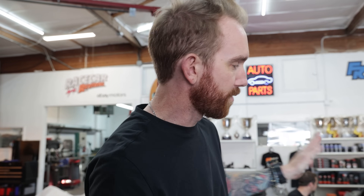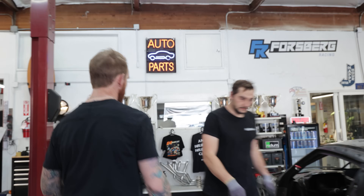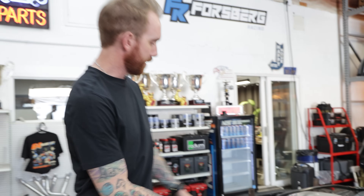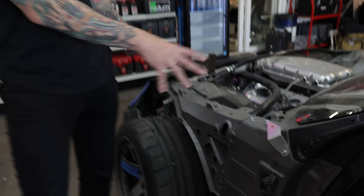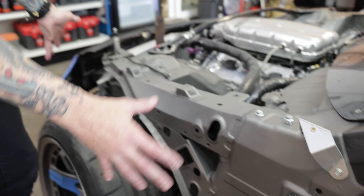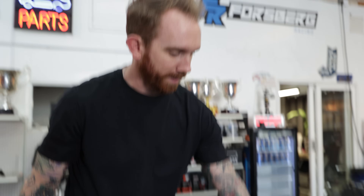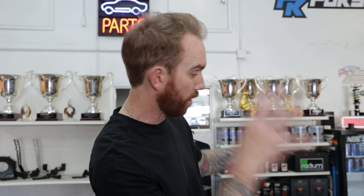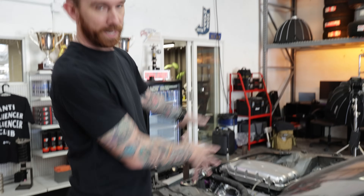The car is just very much ready to go mechanically. Now we just got to put the dress on her. Pierre and Jackson have been building out some lightweight brackets for the fenders so we can actually remove the steel stock fender that was underneath. The Street Hunter fenders, just like most aftermarket fenders, they're caps — you still utilize your factory fender with all the mounting brackets. We're making them out of aluminum, removing that whole sheet metal piece underneath, which is going to save us almost 20 pounds between the left and right side off the front end.